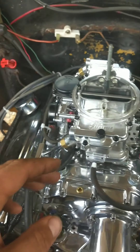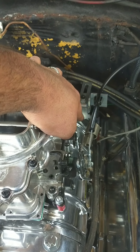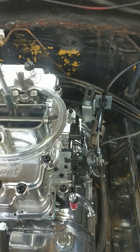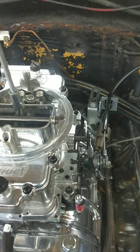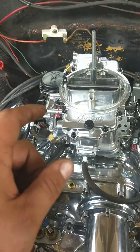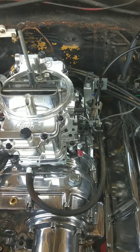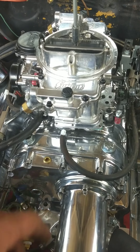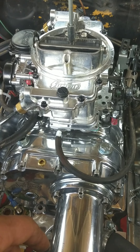Now they do make a thing, and I was kind of happy — this bracket came with the supercharger that has a spot for that little square thing right there. That's where a kick-down cable would go for a 700R4 transmission. They make a vacuum modulator valve conversion kit for Turbo 400s where it uses a cable instead of vacuum, and then you use a 700R4 transmission cable. So that's probably what I'll do, but those things are like $200 — and as much as I hate to say, this is a budget build, it's slowly becoming really expensive. So that $200 is going to have to wait.